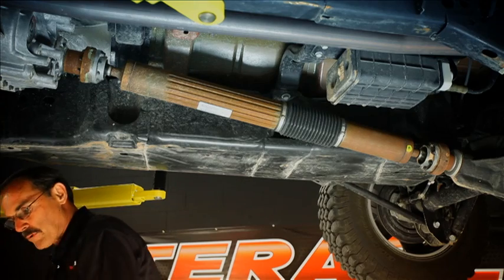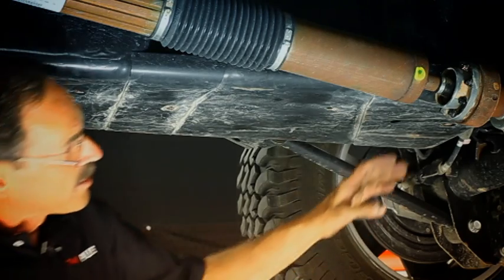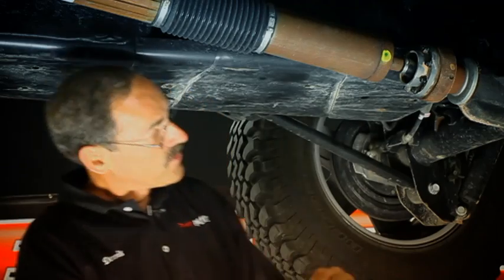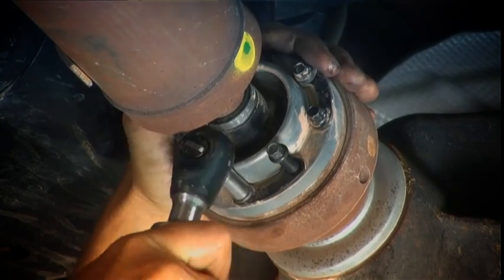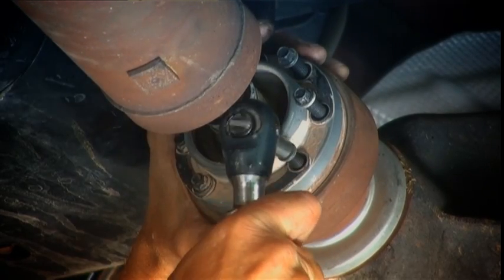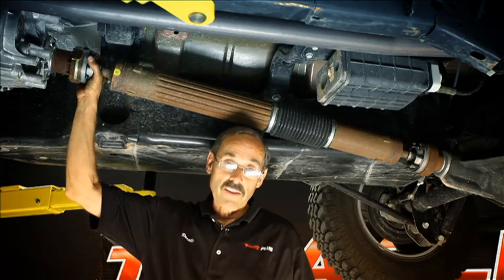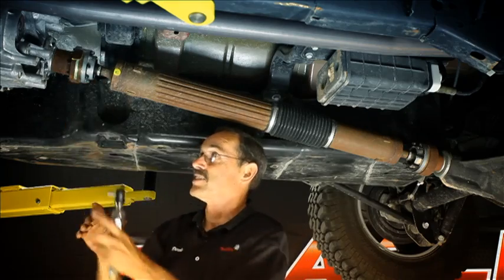We survived that, and we did pretty good on the garbage can — we caught all the dirt. We'll get this out of the way and start on the driveline bolts. There are eight driveline bolts at each end and they're kind of long-threaded bolts. If you're doing it with an end wrench — we've got a little air ratchet here with a 5/16 socket — they just come right out. We'll go up and hit the front ones. Once we've got all of these loose, the driveline is captured in the yokes on the diff as well as the transfer case, so it's not really going anywhere.